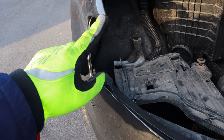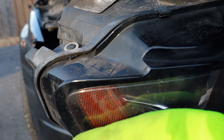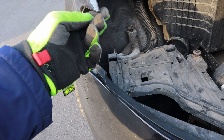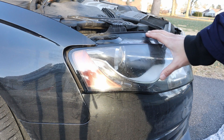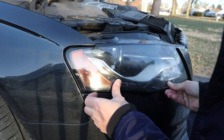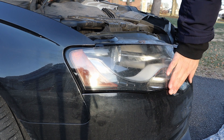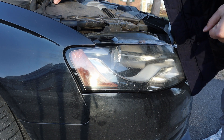One of the other issues is the rubber seal attached to the headlight. There are two little holes up here and it's going to clip in right around here. On mine, it looks like they are broken off — that's why it fell off so easily. On the driver's side it wasn't that way. When you originally push it in, it's going to go past here and you have to move it forward a little, so you don't want that seal to get caught up. Just make sure it stays in place underneath here along the housing. Make sure the seal stays tight and feed it right back in there. Headlight is flush — you'll notice a slight piece here that comes out, that's normal. The main thing is just make sure it lines up with the two bolts. Also make sure your quarter is not tucked in there or you'll have to take it out and do it all over again.